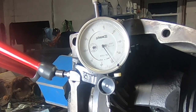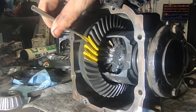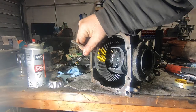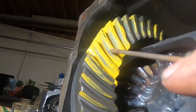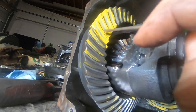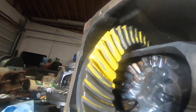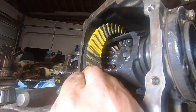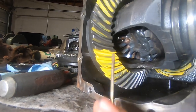Right out of the box: four-and-a-half thousandths of backlash. Spec for this backlash is two-and-a-half thou to five-and-a-half thou, so we are at the looser side. I'd like to go tighter based upon what this thing is going to be used for. I'll tell you what - that pattern looks really good. We are centered heel-to-toe on the tooth and also centered from the root to the top. I'm totally okay with that pattern - pretty good on a used set of gears. The coast side looks pretty good as well.